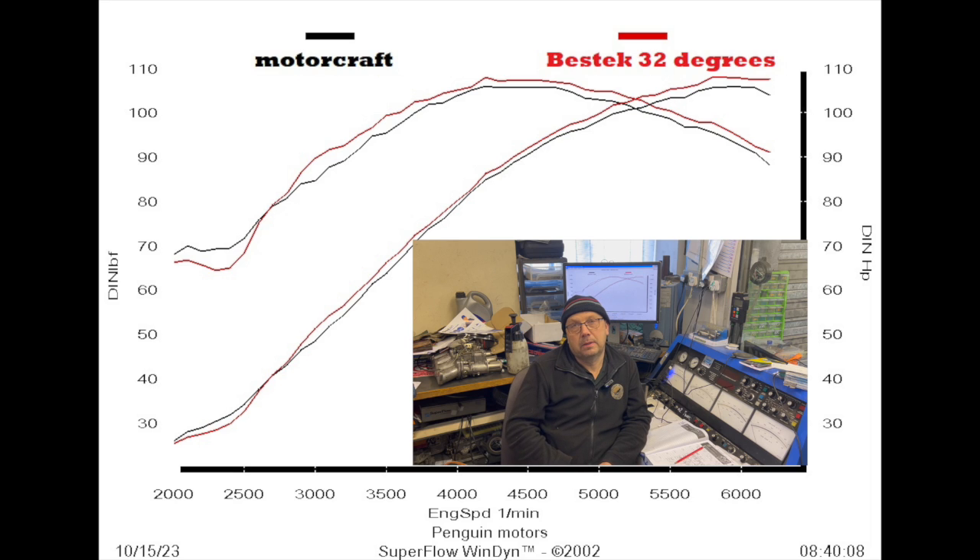I think it's actually a win-win. We've proved what I set out to see: could we put the performance distributor in an otherwise nearly standard engine, so we can fit some Webers at a later date — and will it work okay? Not only did it work okay, it did actually give us some more power. So on that bombshell, after you've liked, shared and subscribed, watch out for the next video where we get more interesting — because then we do fit those Webers and really test this distributor. Catch you on the flip side, guys.